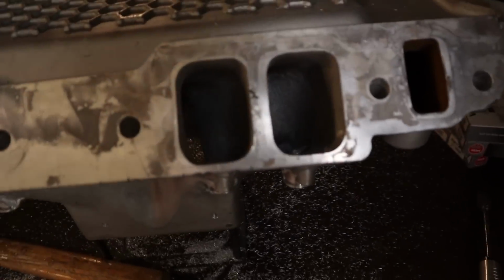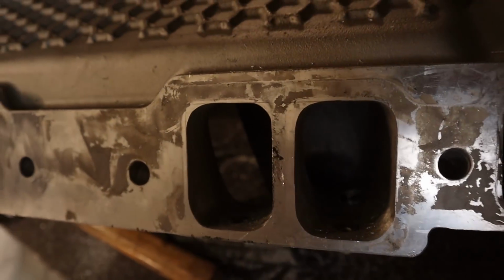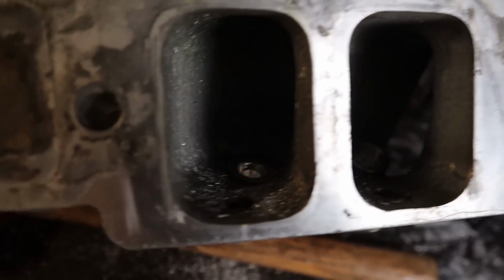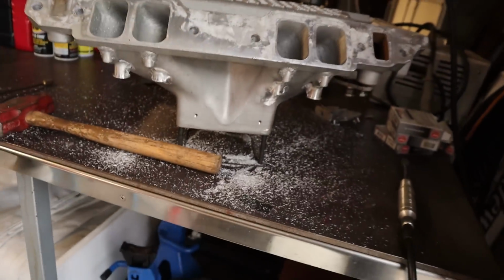So it's fairly early. I think it's like 7:30. We've been out here for a couple hours. I'm roughing in the intake right now. So we got these bungs, the injector bungs and everything. That's what they look like. First, you knock that off. So, I'm just roughing them, and then we'll go back behind and smooth them up, and the intake will be ready to put on.